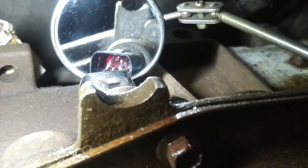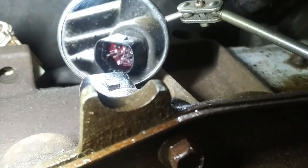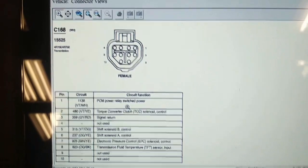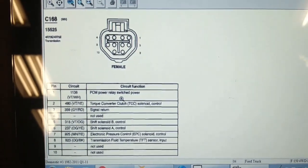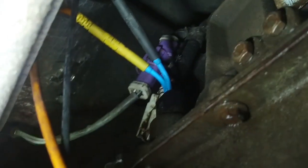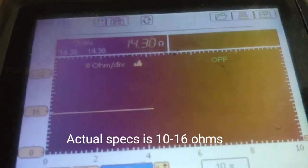I need to get a pinout since I don't have a harness for this, to put an ohmmeter across pins 1 and 2 of connector 168 at the transmission — there's no pin 4, which makes it easy to identify. I've got the test leads connected and I'm measuring a resistance of 15 ohms, which is a realistic number. On a more precise range it reads 14.3 ohms — I'll check the spec but that sounds reasonable.